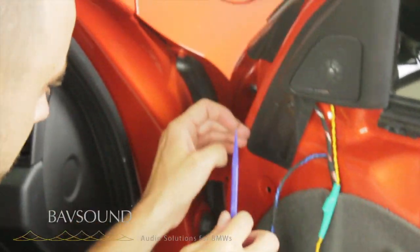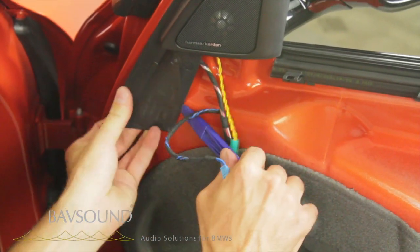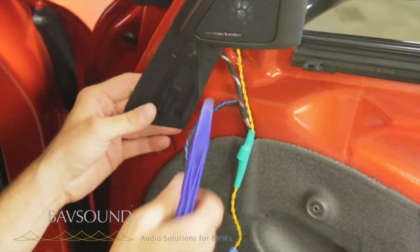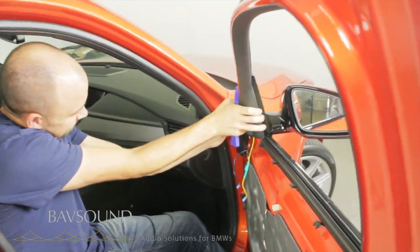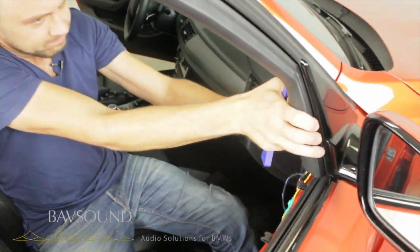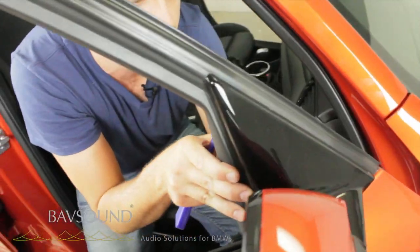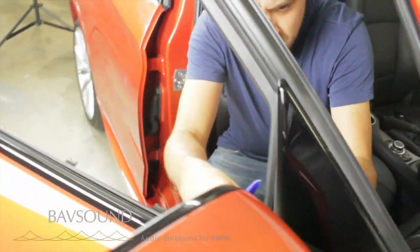So now we just basically need to extract this and it's just held on by a plastic clip here. So there's a couple of those, there's another one right back here. We're just working through them — that one was tight. So now we see we just pinched these little clips. They both usually stay in the door and those are just going to go on the little male tabs here and here when we put this back together. So just remember to do that — don't forget it.